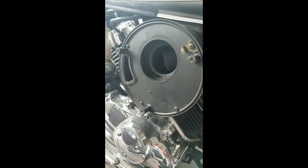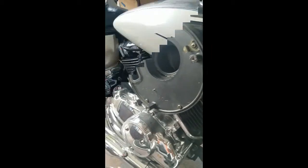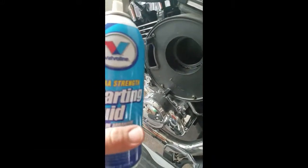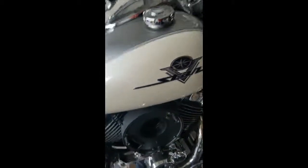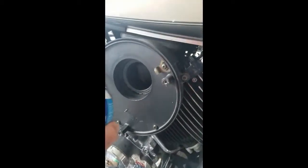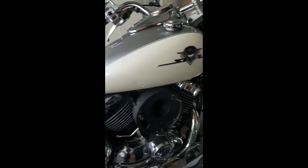I'm going to show you a more in-depth perspective as to what you can do to hopefully get your cold bike started if it's giving you a lot of trouble. I feel like I owe it to you guys to actually show you how to use starting fluid in your engine if it's not starting correctly. I have the air filter off here. I'm going to attempt to start my bike — you can see it's giving me a little bit of trouble. It's not wanting to start, even though I have the choke completely out. It's about 45 degrees, so I'm going to spray a little bit of starter fluid right into the carburetor. The engine got a little excited and picked up just a little bit there.